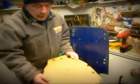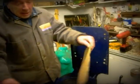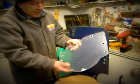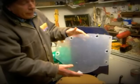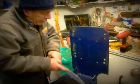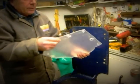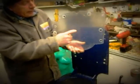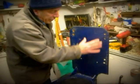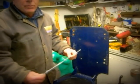Once we've got our template transferred onto the sheet plastic, we get the plastic cut out into the right shape. We just get it cut out roughly, and then mark all your holes by going back to the original bracket and marking everything out exactly. So we've got our peripheral holes drilled here. Now we're going to get this one marked and drilled, but to do that we have to put this bracket back on the transmission casing, which we shall do tomorrow because it's about 12:30 now.